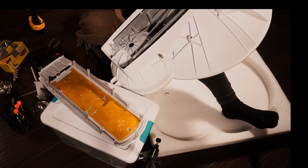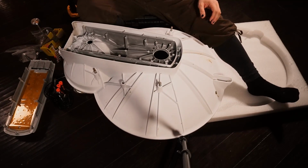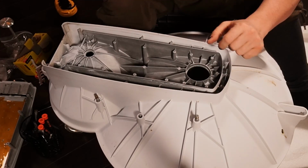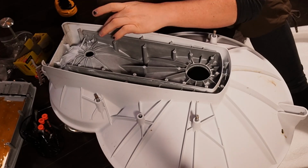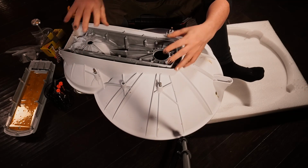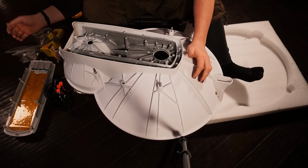So, look here. All right, hold on. I gotta be careful at how I do this now. This is all metal now. So if you look here, this is the top. See how there's this little housing here? This little frame, this little piece that's in place. So when this is married in, all the screws that actually hold this thing together are now outside of this container, the actual RF can here, right? So if water even got in, it's not going to do anything because it will just go out and around here and it'll drain out the bottom.